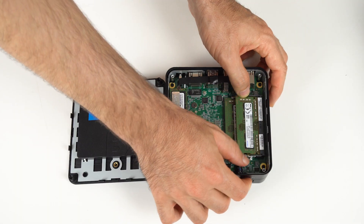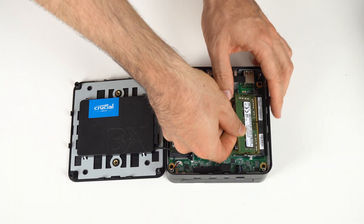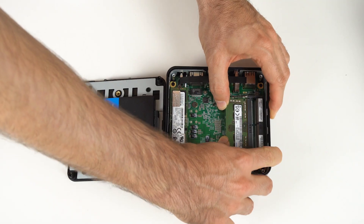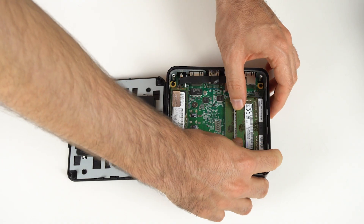Gimme metal, dammit. Both the UM560 and UM580 were very picky with memory — neither would boot with two sticks. Resetting the memory didn't help either. What worked was to put a single stick in the bottom slot first; that booted, then I added the second stick and it booted. I ended up doing this for both units. Weird, but whatever.